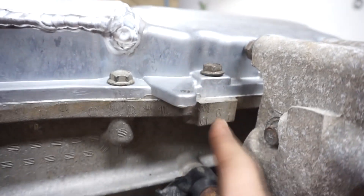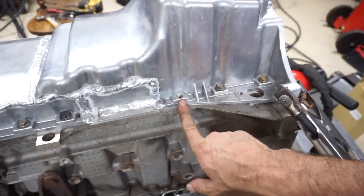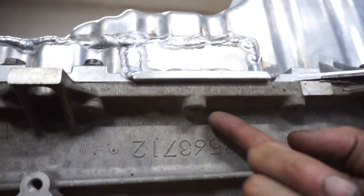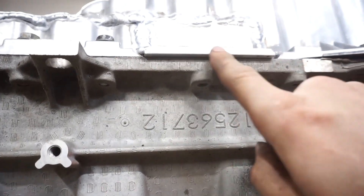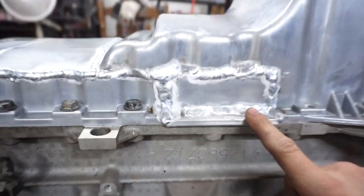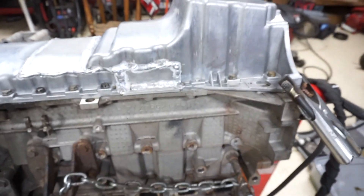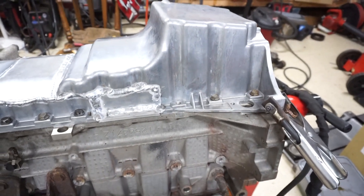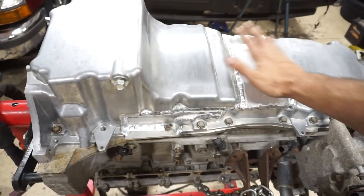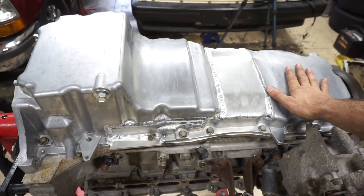This one here didn't have a hole in it, so I drilled and tapped it. I marked a couple more under the punch. I'll take the pan off and drill and tap those so I can just run a bolt in. This one I ran a bolt through the back side so I could put a mark on this little flange where that hole comes through — that way when I take the pan off I'll be able to drill that one too. This thing is completely cool to the touch now, so I'm going to take it off and weld the insides.